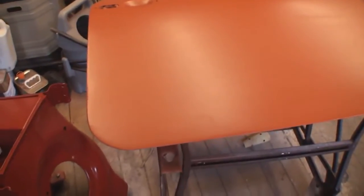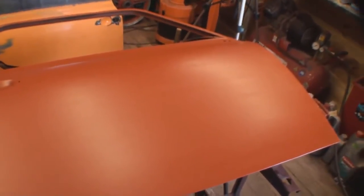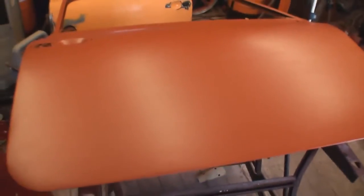What we've done basically is fill the door, and I've got him to rub it down, and I've also got him to put it in a primer. So all we've got to do now, he's quite happy with the results. It's not too bad. It still needs a final coat of filler, which is like a stopper type filler. You can probably see here, if I just get you in near enough, there's a couple of little sand scratches there and there, which we're going to skim over with a bit of stopper filler. The actual door has a slight, very slight outline there.